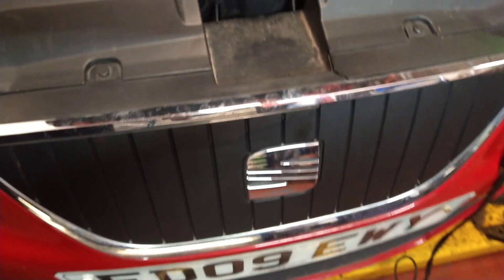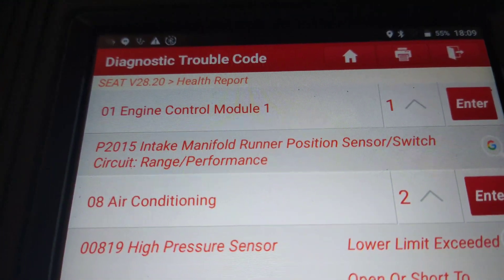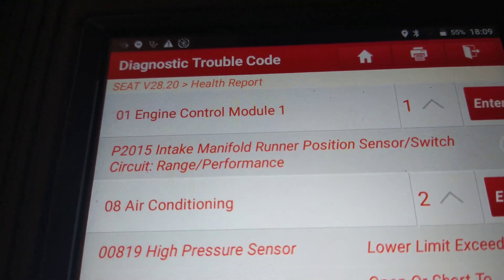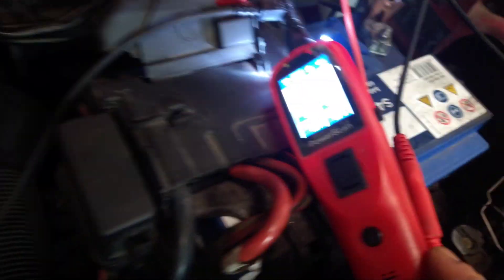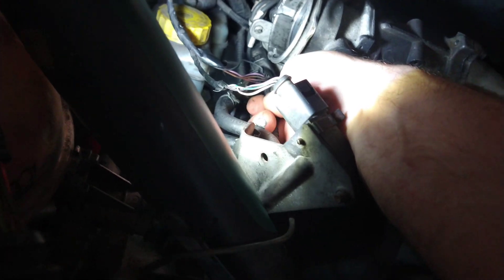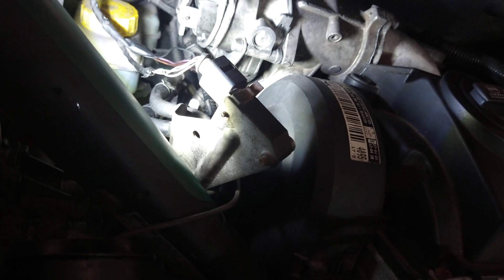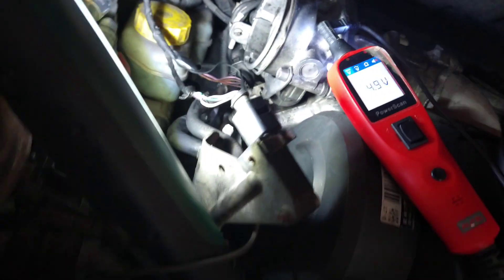Today I've got to see this vehicle. It has an engine light on and I've been asked to look at it. It comes back after driving a few miles. It's got the BMS diesel engine. I checked the fault codes using the Launch and I have an intake manifold runner position fault. This doesn't have an intake manifold runner position but it does have an intake valve. So I'm going through all the pins at the intake manifold valve with the power probe one at a time to see what voltage I have at each pin, to make sense of what's going on and why it's not working.